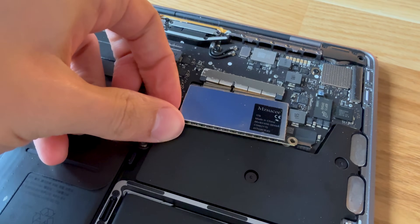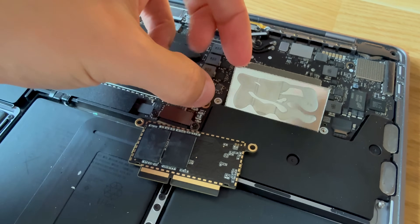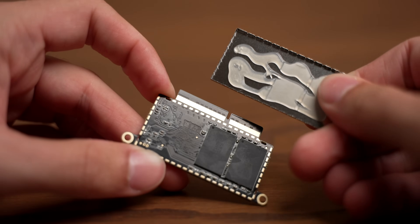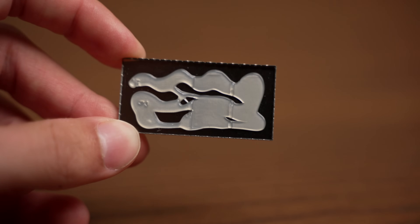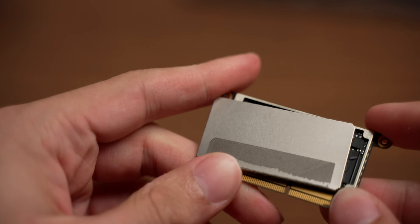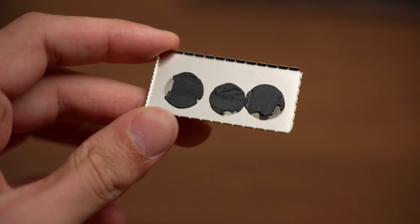When I went to swap the mmmSucky drive back out of the MacBook, a piece fell off of it. When taking the drive out, the heat spreader fell off, revealing that it's hot glued on. No wonder this thing throttles — because the heat spreader isn't a real heat spreader. It's just a random little piece of metal glued on to make it look like the original Apple SSD. If you take apart an Apple SSD, you'll notice the heat spreaders are held on with metal tabs and a frame that goes around the SSD, with a thermal pad on each NAND module to transmit heat to the heat spreader. The mmmSucky does none of those things.